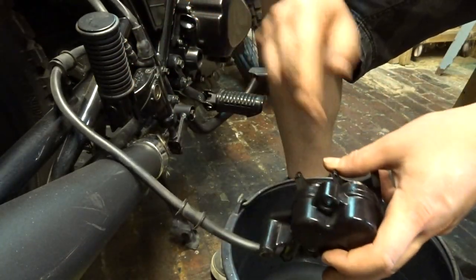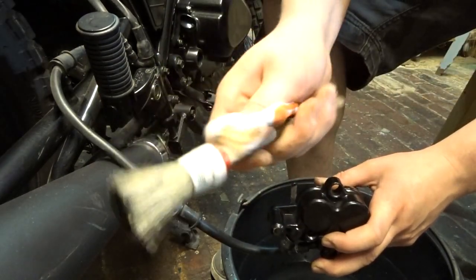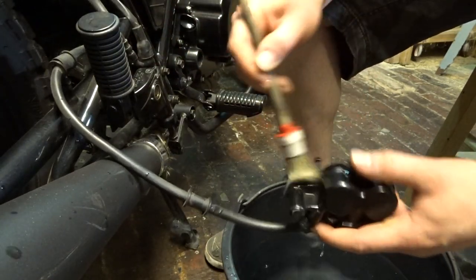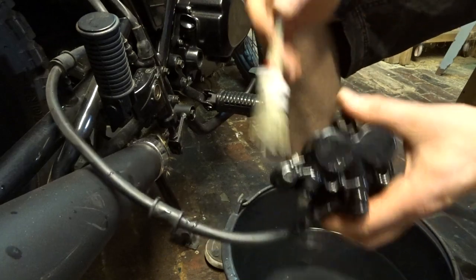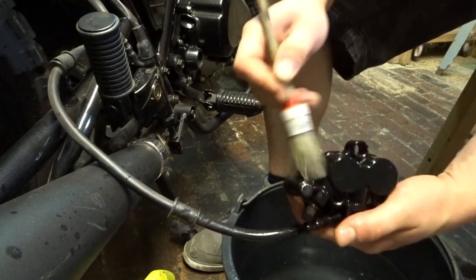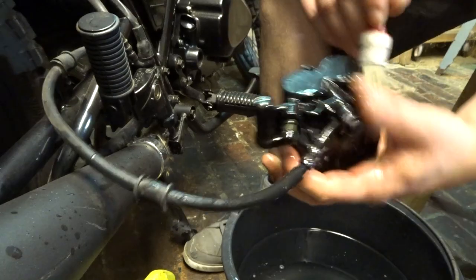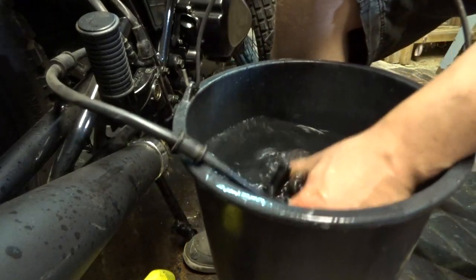To clean the pistons, get some water, some wheel cleaner, and the brushes of your choice. I use a printer's brush and a toothbrush. Wet the whole brake caliper — this is a good way to clean it all the way. Make everything wet and then apply the wheel cleaner. Scrub every surface with your brushes; make sure you hit the piston walls and get them all nice and clean, removing all the dirt. Then rinse by dunking them in a bucket of water.